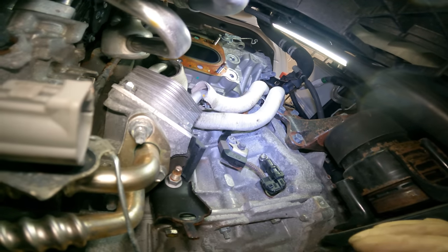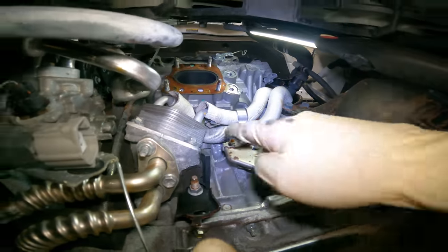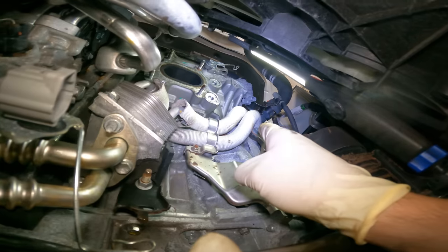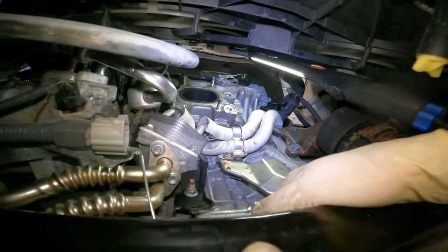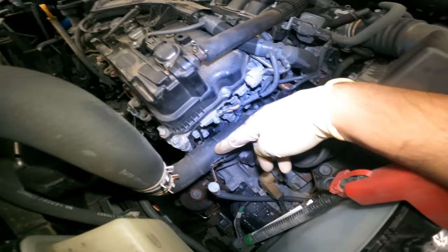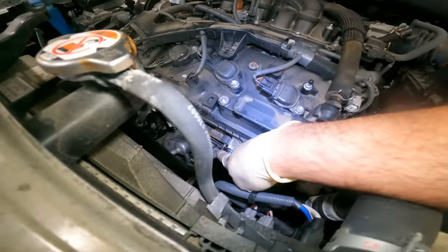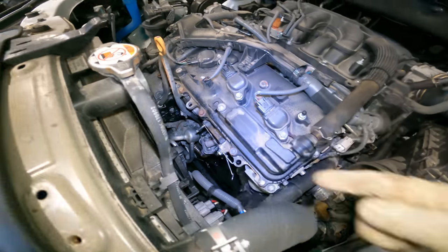Since I already had it off, I installed the small bracket because it was still stuck to the old harness. Now we're ready to install the big bracket again. We are all installed. We're going to replace the exhaust gaskets, make our crank sensor harness connection up there, and install the other 10 millimeter bolt with a new gasket. We're definitely on the back half of the job. The upper radiator hose and harness are back in mounted position. We installed hot bolt paste on the threads — Audi habits die hard — and we are 100% ready to get that cat back in.